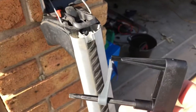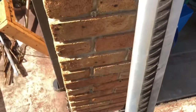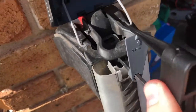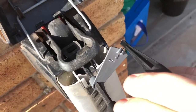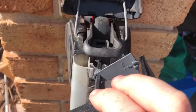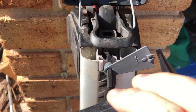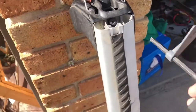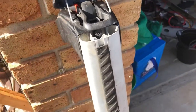One of the strange things you'll find is this little tool here. If you actually look at it, it's got a nine Newton metre mark on it. What this is for is tightening these — these ones have already been done. Basically, you should be able to get to the point where the top black plastic lines up with the nine Newton metre mark, and that shows that you've tightened it appropriately. It does say in the factory instructions that you should be checking the tightness every thousand kilometres to see if they haven't moved.